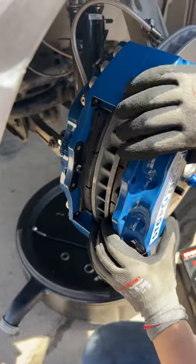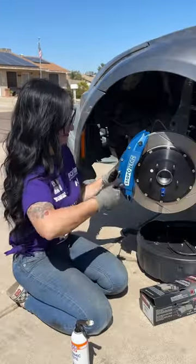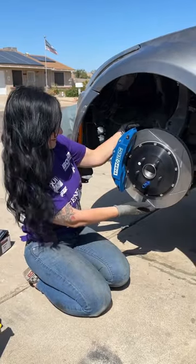I'm going to put the bridge back in, but before I put the bolts in, I'm going to go ahead and use some ceramic paste. All I have left is to bleed the brakes, bed the pads, and we're set.